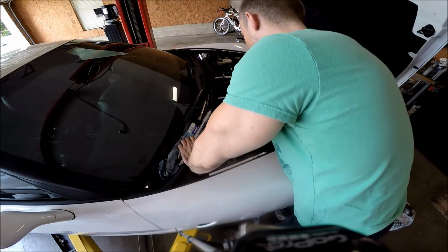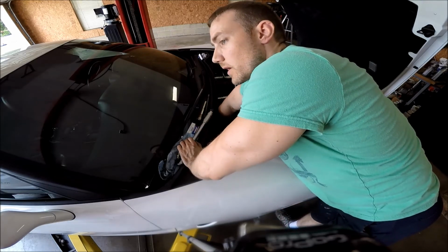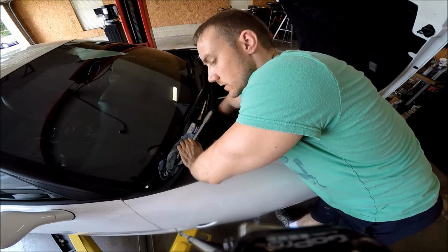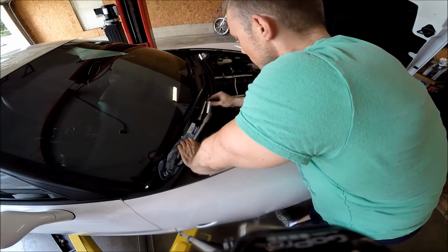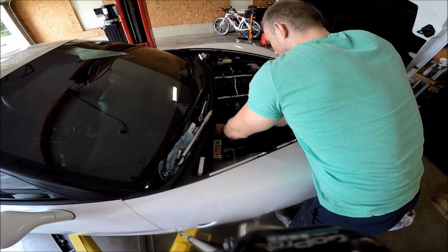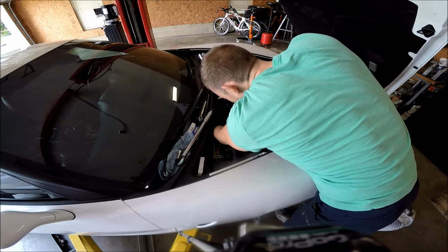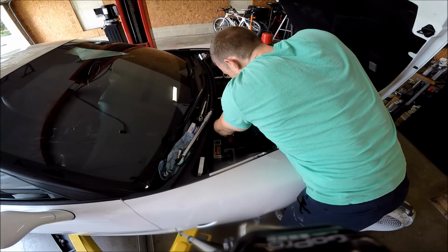because I've learned that my snug is about 25 or 30 foot-pounds is what I feel is snug. Tight is about 60 foot-pounds for me. When you've been doing it as long as I have, you just kind of learn these things. And they've already got dielectric grease down in there from the last set.